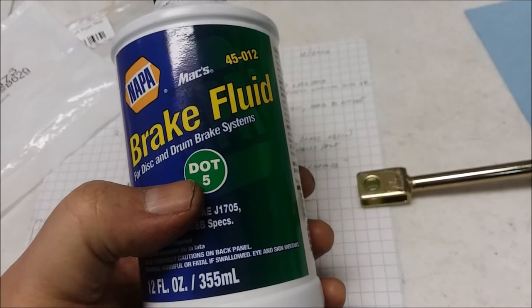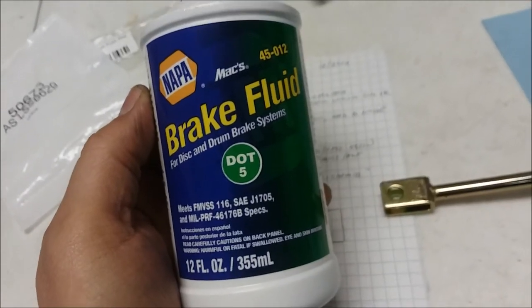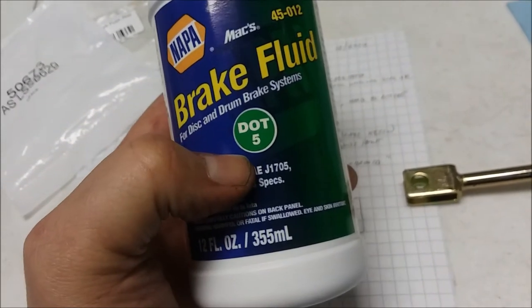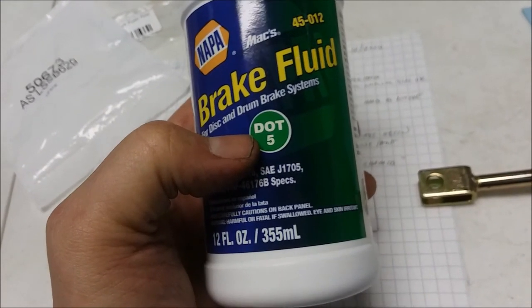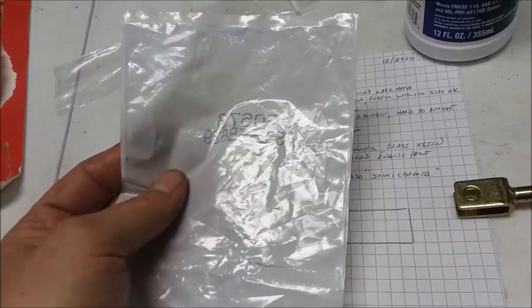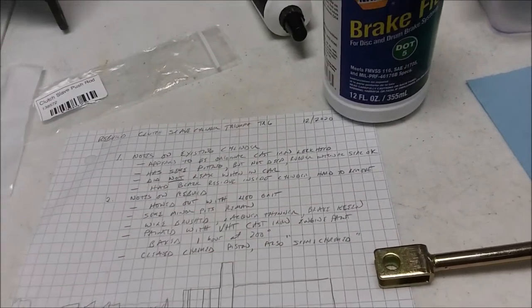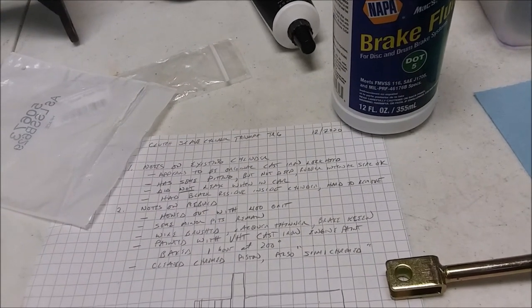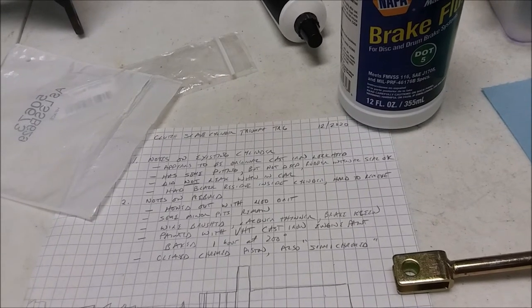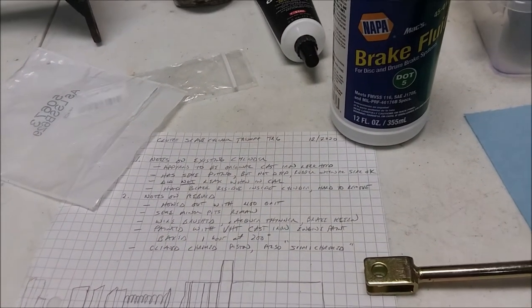Brake fluid was a problem on seals made back in the early days, way before, but in my opinion, and you have to do your own research here because I don't want to be liable for your decisions, look it up and you can see all kinds of arguments about it one way or the other. In my judgment, if I bought a new set of seals, brand new, they're going to be decades past when we had a problem with seals. If you really want to fool with this, I did at one time make an experiment, and I took different kinds of rubber seals and I dropped them in different kinds of brake fluid because they will swell up within a couple of days if they're going to have a problem. If you want to have some fun, you might do the same thing. Take some neoprene and some other things and try dropping them in brake fluid and see what you get.